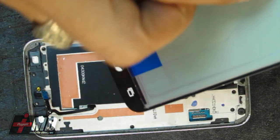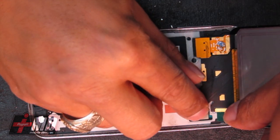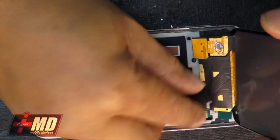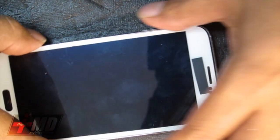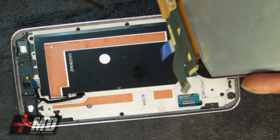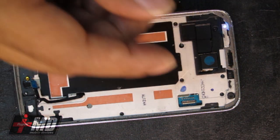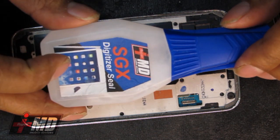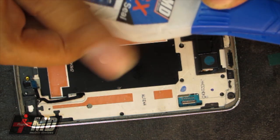Got my second screen here — I'm going to test that out also. The Galaxy S5, when they built this, they built it to be watertight. So the way it's structured, once you break it and put the new glass in, you introduce the opportunity for water to seep in. You'll need to restore it to its original state. My glue — available from my eBay store at the link below — is called STX. It's a digitizer glue made from silicone and it is watertight — probably even better than the original glue.